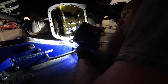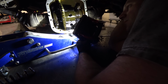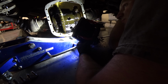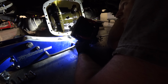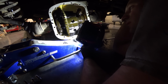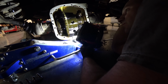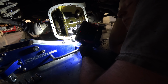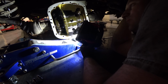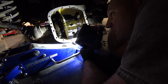Maybe this is some kind of common rear end and we could find a locker? Probably not in time. Because then we'd have to shim it. Probably new bearings and seals. And it would turn into a 10-layer onion. And you'd wrap up $1,000 or more in it. It'll be $500 for a locker, that's for sure. I didn't think about the price of the locker. I was thinking of the price of the bearings and shims and gaskets, and I say we just hose it out. And then start filling it up with the old spool.